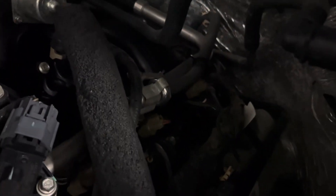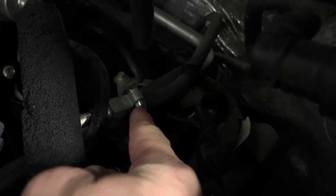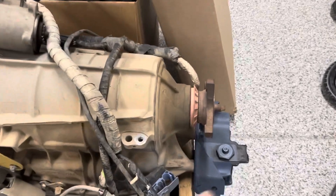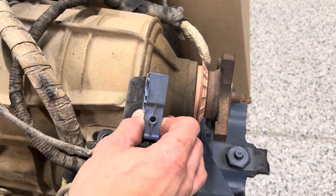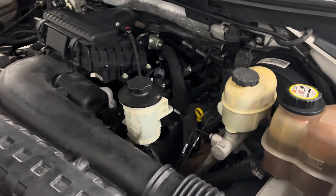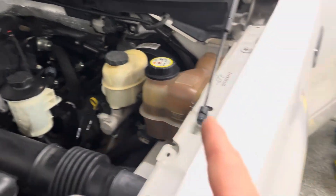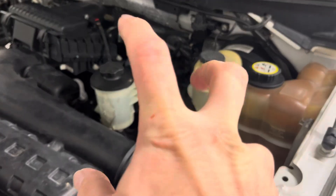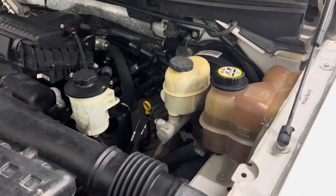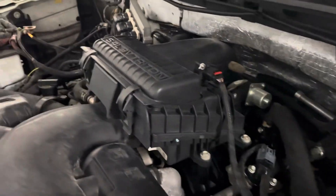One other thing I'm going to have to kind of create is — the three valve decided to use a bigger different kind of quick disconnect. So in spirit of keeping it kind of OEM type, I'll make my own line with the quick disconnect and reuse. The three valve does it the same way — they have a bracket that holds the fuel and evaporative lines, and the lines just go up towards the tranny and stay down with the chassis. With fuel stuff, I just have to make sure that plastic hat has room to drill into and have a return fitting go back. The fuel filter looks just like the Mustang one and I should be able to use the Wix filter, just like the Mustangs.